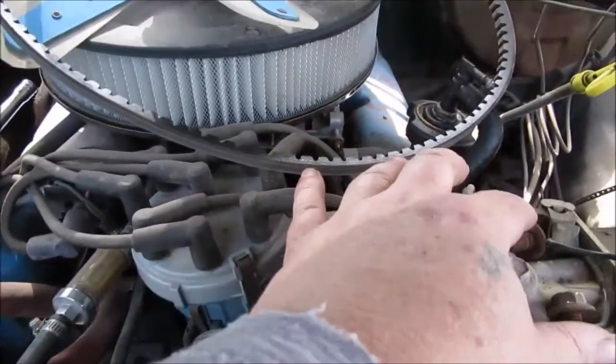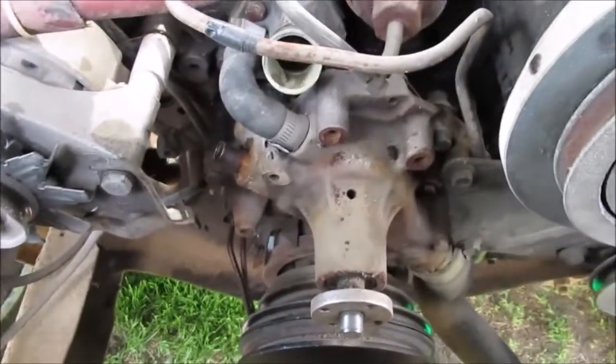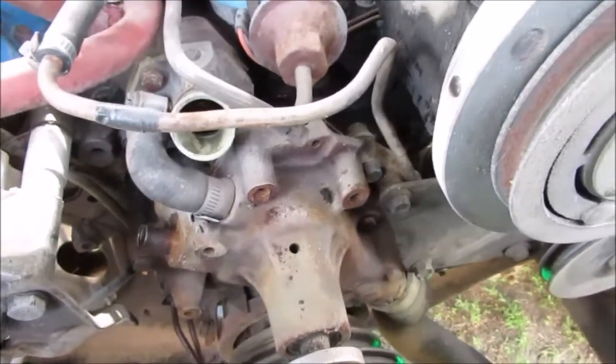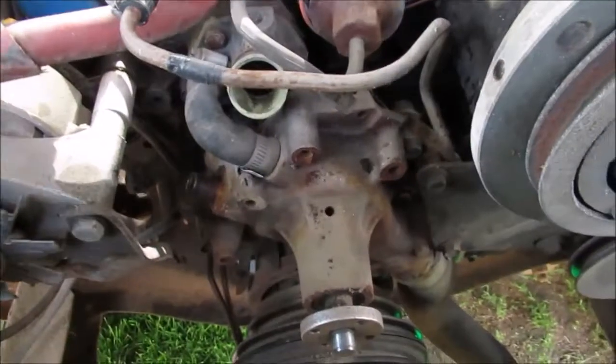See that bracket? That's where it goes — two bolts here, put it back in. These two bolts went down here. Next thing you do, you got to remove the power steering bracket. I'm gonna get a piece of cardboard to put all these bolts in to make a pattern.